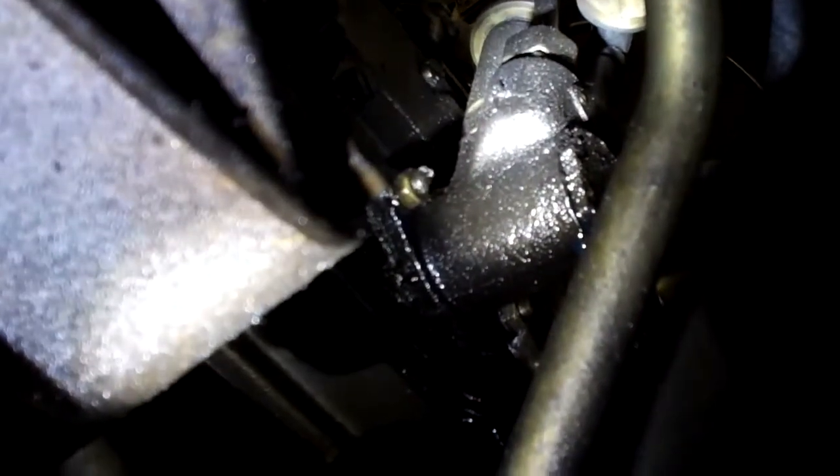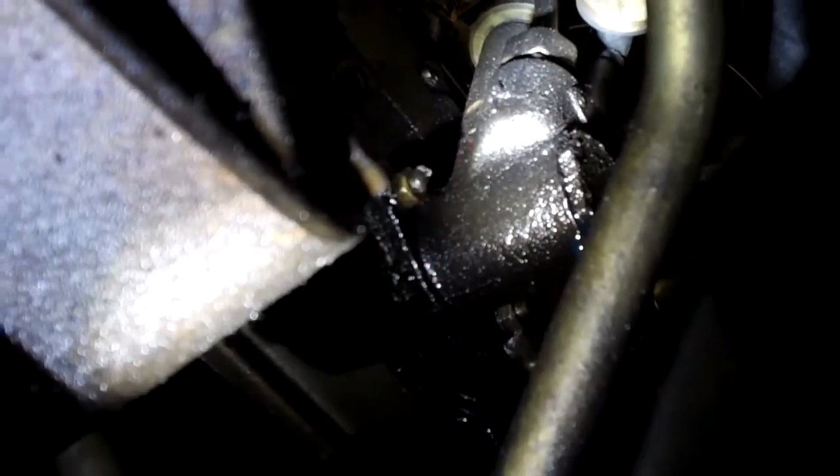The next thing I'm going to show you is that the car has a fuel leak coming from the bottom of the fuel injection fuel pump. There's a little fuel leak right there where the red LED is pointing. It's not the pump itself, but the fuel pump for the fuel injection pump is leaking, and it's really wet here with diesel fuel. I recommend we try and replace the gasket for the fuel injection fuel pump, and also change the fuel primer pump, which is a little bit above that — both may be leaking.